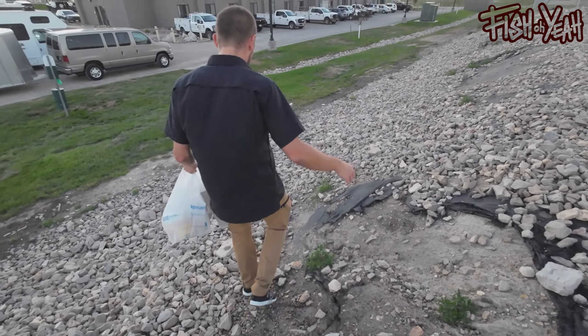So we woke up in the morning and the truck still started, so our fuel pump sock cleanup job worked out pretty good, and we made quite a few miles today. We're actually in Utah again already — we're over in the Morgan area, the eastern side of the mountains. And yeah, we are almost home. We're like 25 minutes from Ogden. I've got to find someone to change my clutch for me because I'm only in the States for another couple of days. Ordered a clutch last night. I don't think it's a clutch though — I think it's the slave cylinder most likely, or the pressure plate might have failed, like one of the little fingers might have snapped, and that's why it won't disengage. So I'll hit up a few people locally to see if they'll change it for me while I'm gone, and then in a couple of years when I get back, I'll play with it again.